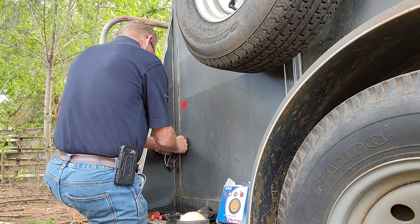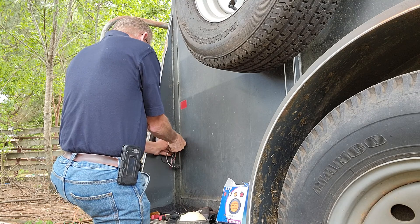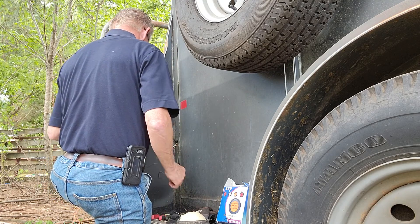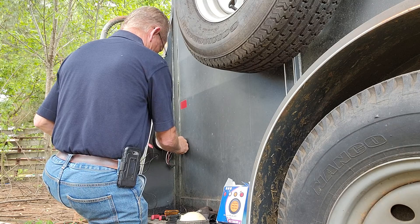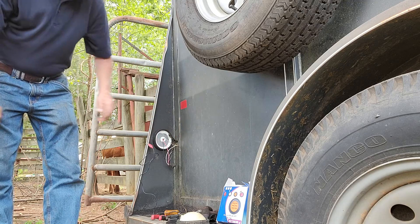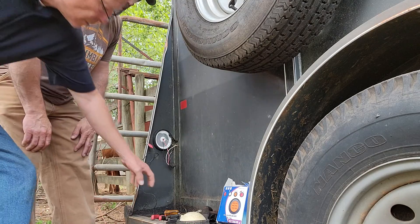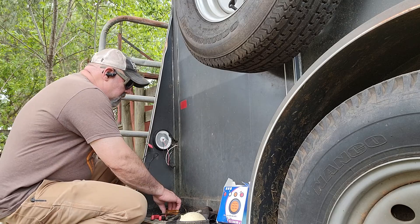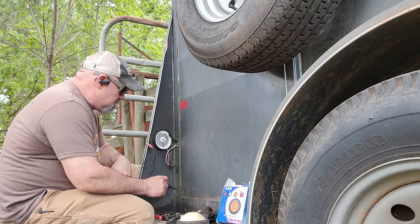I need to — do you have a test light? I do. I need to check that wire before you attach it and see what's on what. I just want to see — the only one I attach is the ground wire. Let me turn the switch on. Turn the parking lights on, turn the ignition switch off, and turn the emergency flashers on — that way we'll have a look at the ground and the brake.